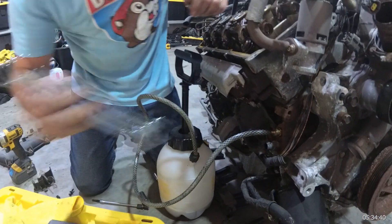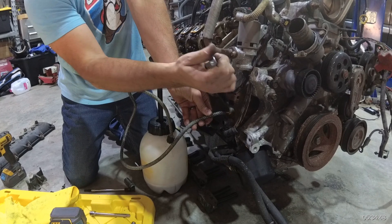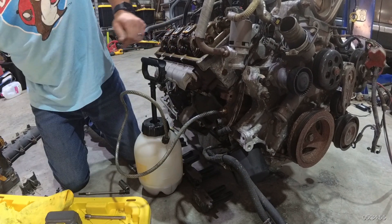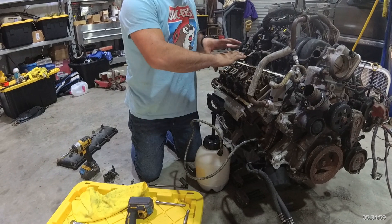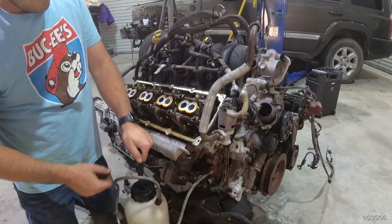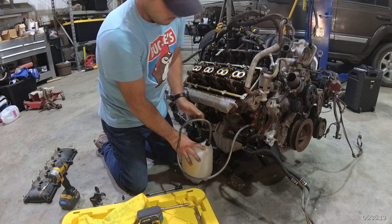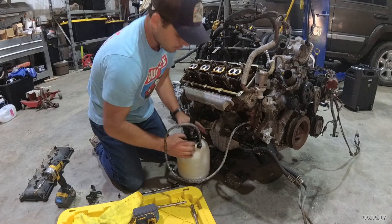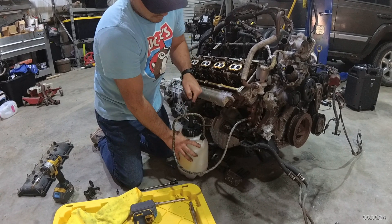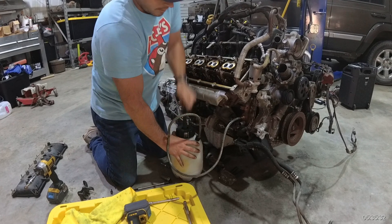Make sure the fitting is tight. What we'll do is pump the handle and look for oil to actually come through in the valve assembly. As I said before, this boss goes straight up to the top of the engine, so it'll help with that. Go ahead and begin the prime — make sure your valve is closed, that'll help. You can feel it getting a little firmer as you pump.